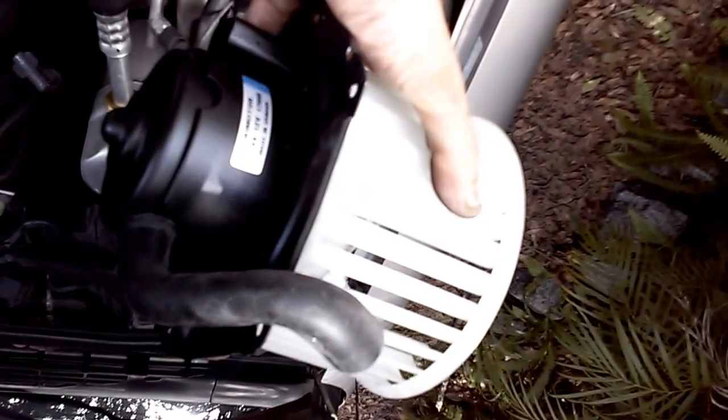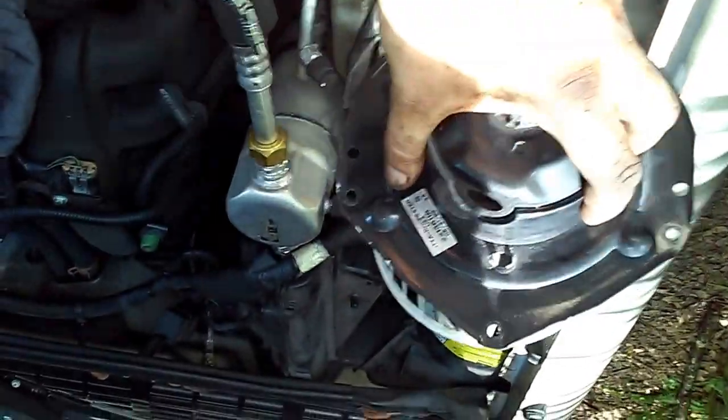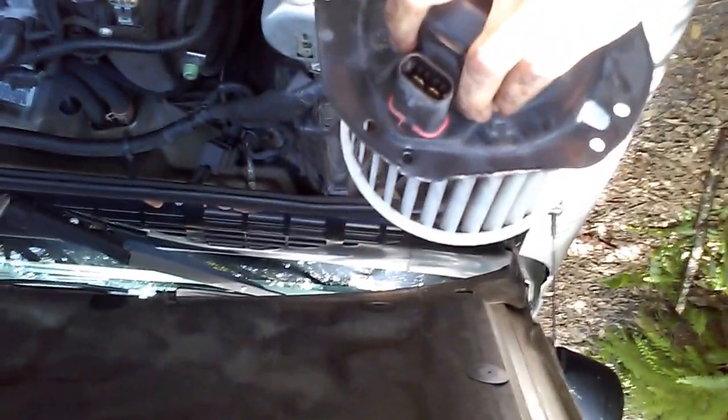Install your vent tube and your wires back. Once you get it in, tighten the screws back down and you should be good to go. The blower motor is in and installed — here's the old one. Make sure to install it with that point up and the round flat spot at the bottom plug down. Once you get it in, rotate it up — use that flat spot on the bottom to get by the stud on the coolant reservoir.